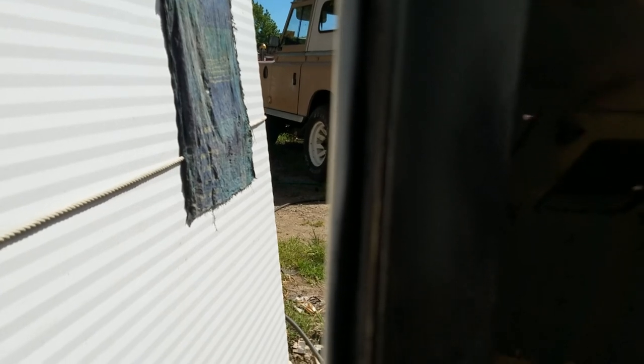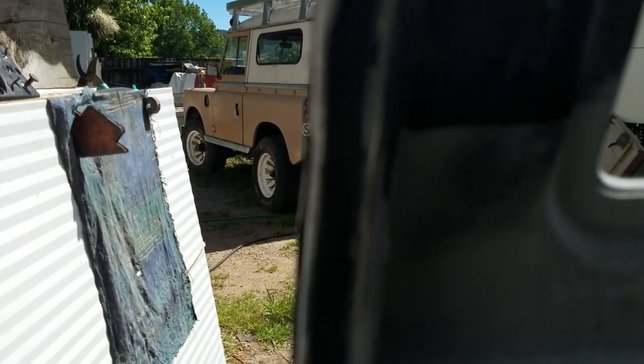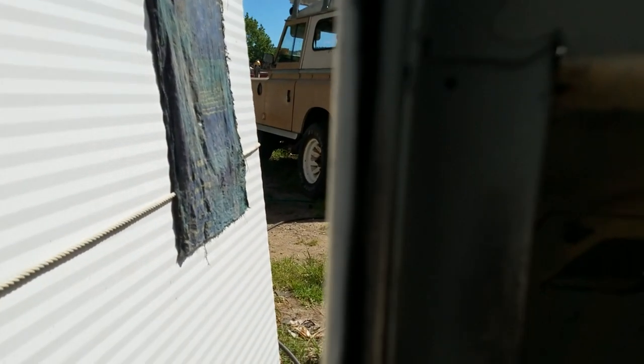This one — well, this is the club sandwich of body joins. There's no less than four separate panels all spot welded together here, and it's a huge rust trap, because water's coming down off the screen and off the bonnet, past this point, and if no measures are taken to waterproof it, water gets sucked into the seam by capillary reaction.